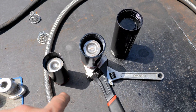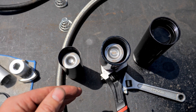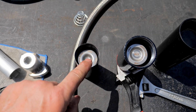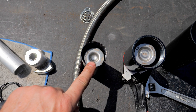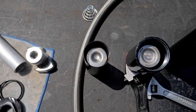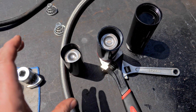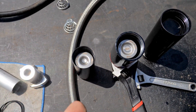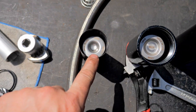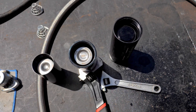A lot of people will dyno their cars with setups like this. But here's the thing — when you're doing a dyno hit, you're not doing first, second, third at the very end of the quarter; you're doing short hits. A lot of people have fueling issues on the top side of the track and don't know why. Check your filters, because you always want to look at what's going to be the most restrictive part in your fuel system — not just fittings, not just lines, but look at the filter element inside the filter body to determine if it's the correct filter for your application.